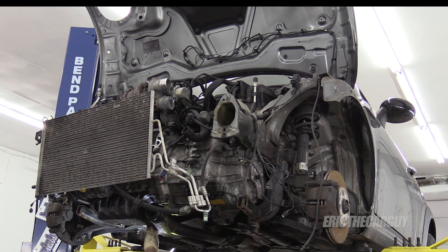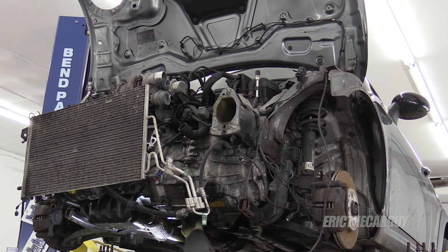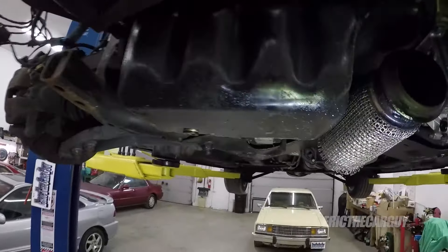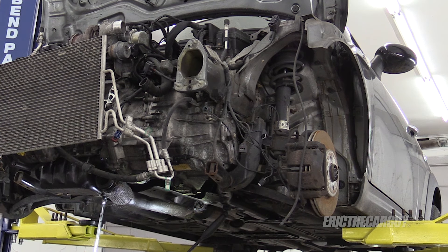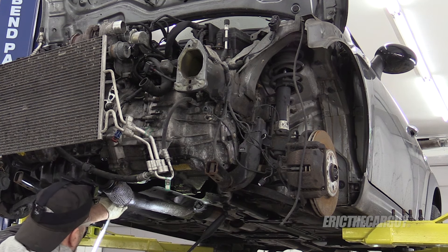Then there's this other engine mount under here that we need to undo. In fact, that may be one of the first things I do just so that I can get access to the fasteners that hold it. There's an intermediate shaft for this axle on this side. Those both feel like 13. So let's just get a start with this mount. And then there's the clutch slave that's got to come out. Let's start by removing this engine mount here. Probably only going to get to that with a wrench. 16. Nice. You can totally take this mount out because those two that hold it on the sides are carrying the brunt. This is just keeping it from rocking back and forth.